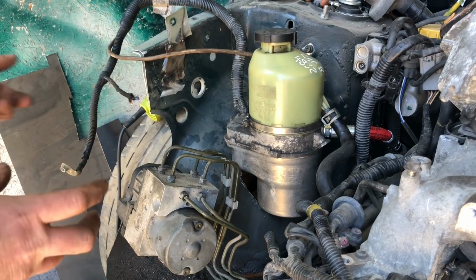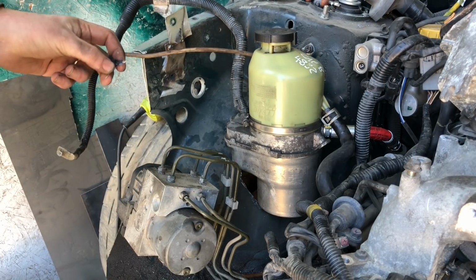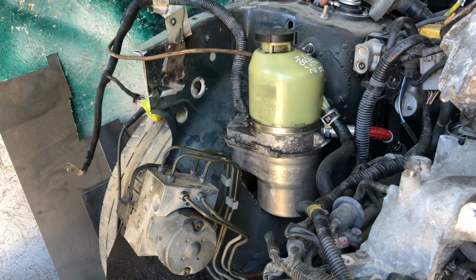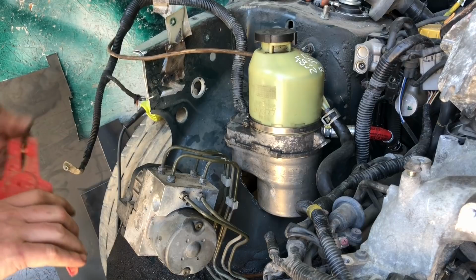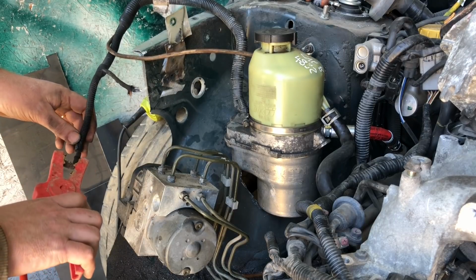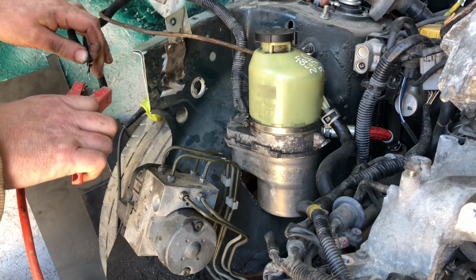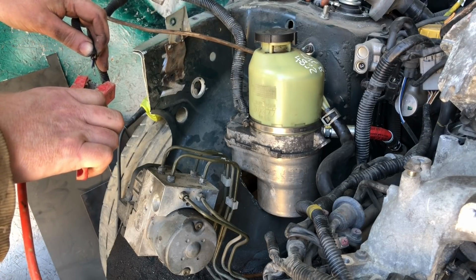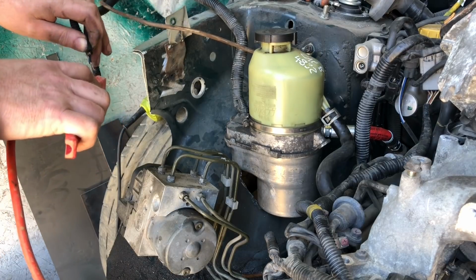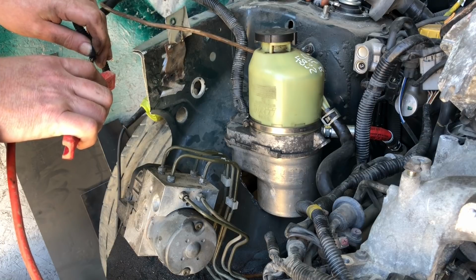So in reality, you basically need to put 12 volts on both the blue and white and the black wire. And that's what I'm going to do with just the jumper cable, because I still haven't found enough cable. I get a tiny little spark off the pump wire when I put that on. But give it a few seconds, because I read on the internet they don't start up straight away, and this one's a bit weird. It takes a bit of time to start up and spin up. Connect.